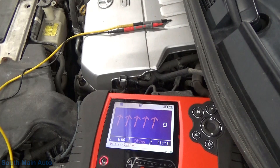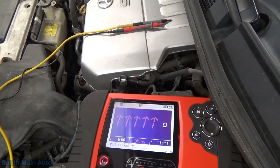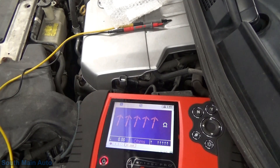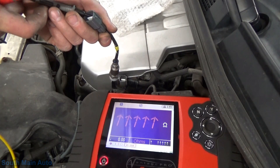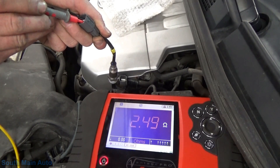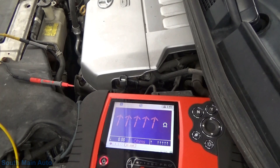Let's grab the new one — we can justify opening the package now. Well, look what they did — they sent us the wrong one. Got it right from Toyota and they sent the wrong one. The cord is way too short. We checked resistance on the new one: 2.5 ohms, so it's good electrically, but it's the wrong part. Freaking Toyota — ordered OEM by the VIN.